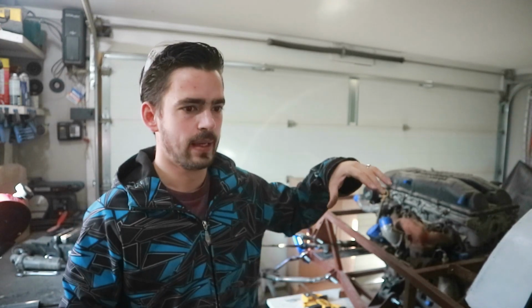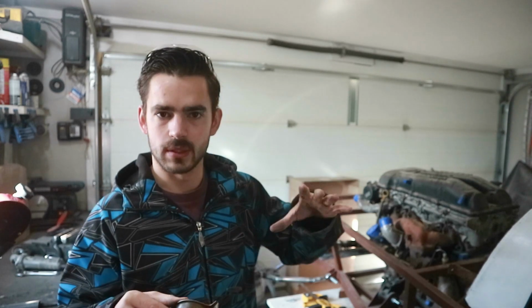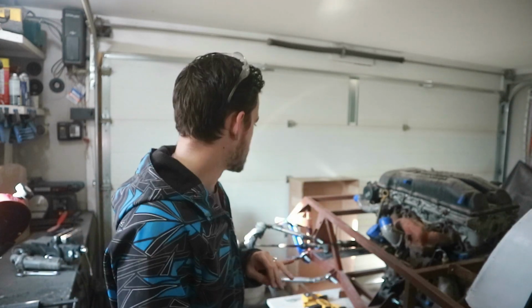And then if in the future we have to lift the steering rack or move it around or tilt it, whatever, we can put some wedges or spacer blocks underneath these horseshoes, and that'll move our rack around how we need it. So let's just measure up a chunk of this angle or channel and cut her up.